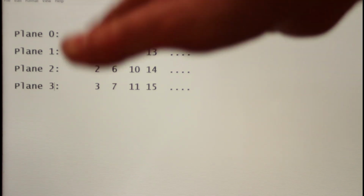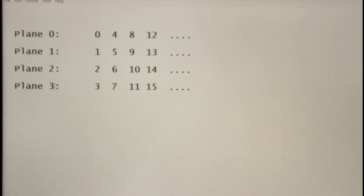Because only 64 kilobytes of graphics memory in total are accessible, you've only got room for 1 page. And you can't do scrolling because if you shift anything, you'll run off the end of video RAM. So this is why you can't do smooth scrolling on MCGA. In the original implementation, it's because there was only 64 kilobytes of memory. And in the VGA implementation, it's because they have to basically emulate that precisely.